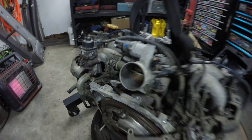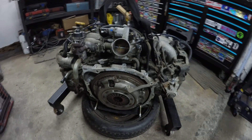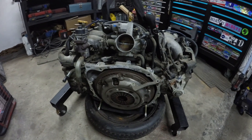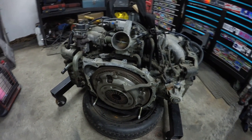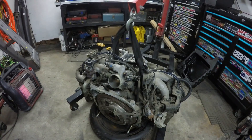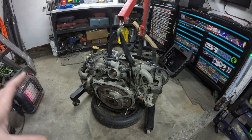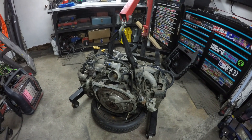Looking a little dirty in there. This clutch was at the end of its days. I mean it still worked pretty good. The hydraulics seemed a little bit weak, or the pressure plate seemed a little bit weak. So that's where I'm going to begin — just get the clutch disc off and set the assembly on to the stand.